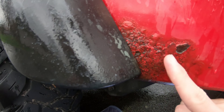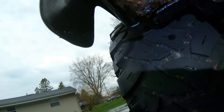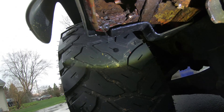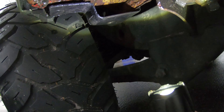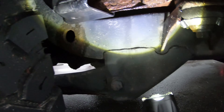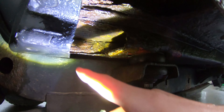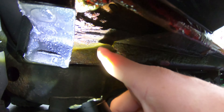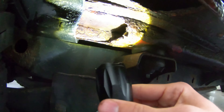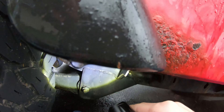This is one bad part - I believe it has rusted from the inside out, and as you can see there's nothing left there. Same thing here. So if you are looking at Jeeps, definitely check here because this area seems to collect a whole lot of water or the salt just sits there. That'll be interesting - something we'll have to look at.